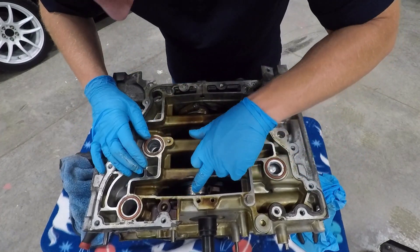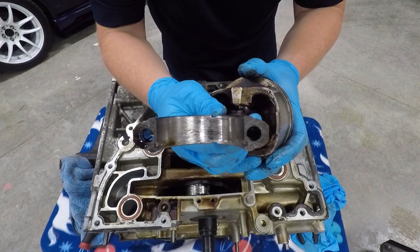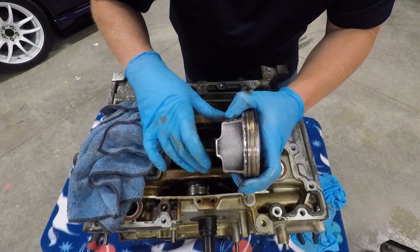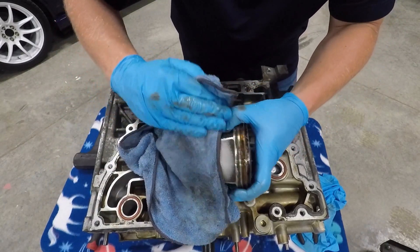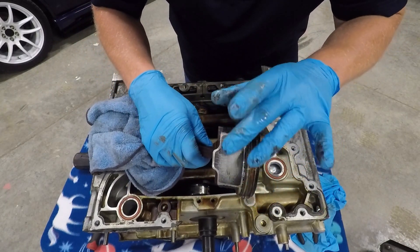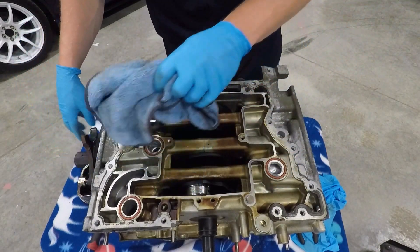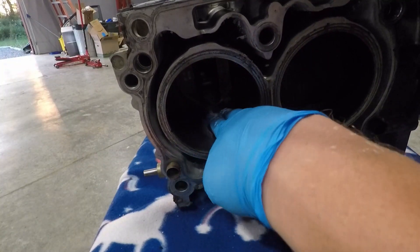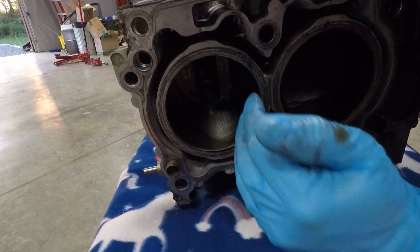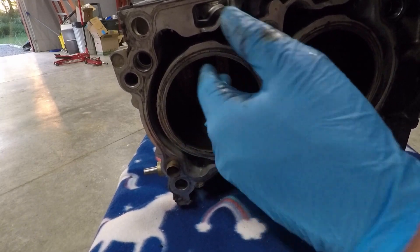The crank is pretty gouged up. Let's pump this one out. Definitely lack of lubrication — that's pretty rough, not good. This one is the same way. That is really rough on camera. This cylinder is basically garbage. Looking at the actual cylinder walls, there is no cross-hatching left — it is literally gouged up and down from the piston going up and down, gouging the cylinder wall pretty bad.